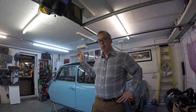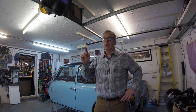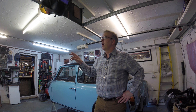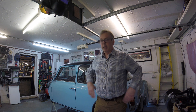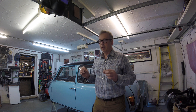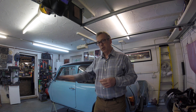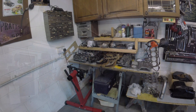I put five strip lights on the ceiling and a couple of wall lights to get plenty of light in. I changed the sockets from just two doubles to a multitude of doubles — I think there are about 26 to 30 sockets in here now, so you're never more than a few feet from a socket. They're all around the perimeter and I've got about four at the top center of the garage so cables can drop down from there. The floor, which was dusty concrete, is now covered in latex — a very hard, fine cement that self-levels and goes super smooth.